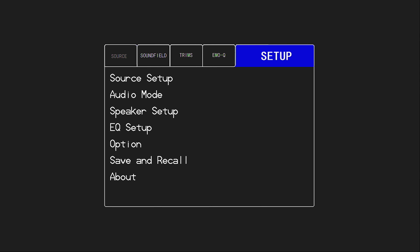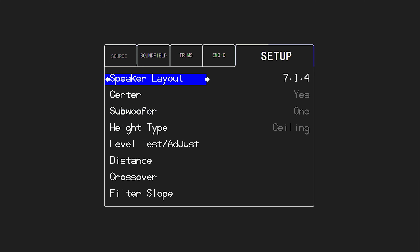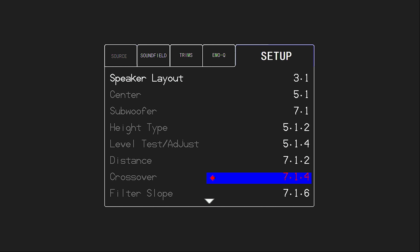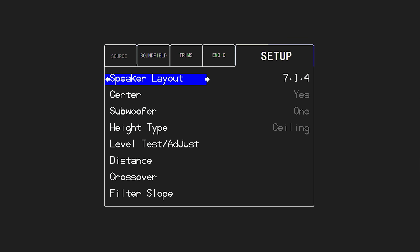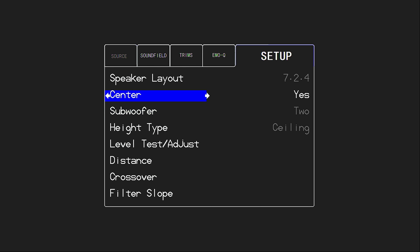From factory settings, I need to go to Setup and then go to Speaker Setup in the menu. By default the speaker layout is set to 7.1.4, but if we select Speaker Layout we'll see various other options. It's really important that we match whatever our physical layout is in our room to whatever we select here. Before getting to speaker layout, if you're running more than one sub, it's important to select the correct number — if I'm running two subs I want to change that to two.